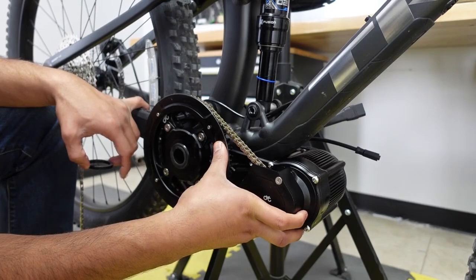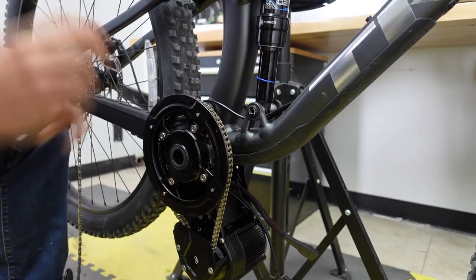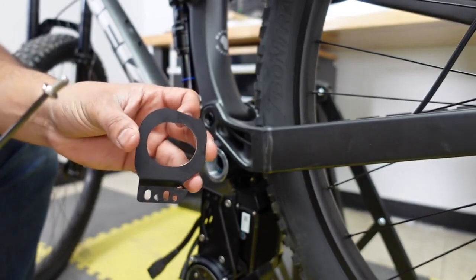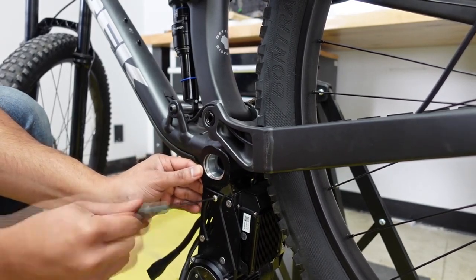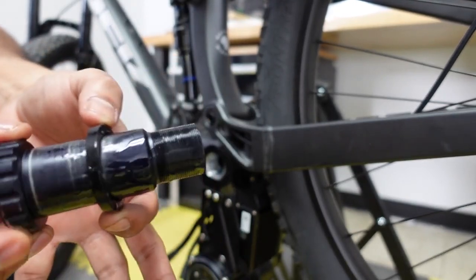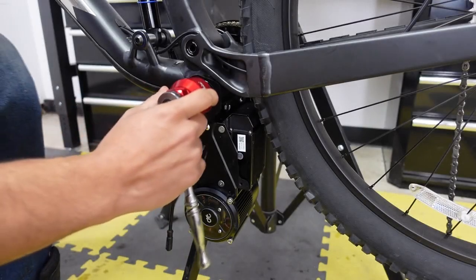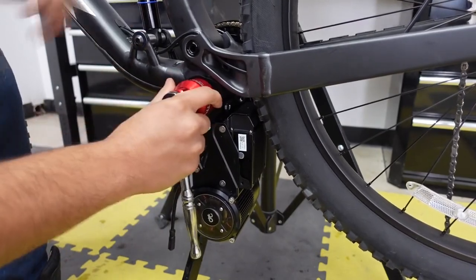Some full suspension bikes have an ISCG mount, which this bike also has, but it's not hitting it so it's going all the way up, which is really good. The CYC has two controller mounting positions — just unscrew the two bolts on the other side and lower the controller position and it will fit most ISCG mounts. Now work on the non-drive side: use the mounting bracket that came with the kit and the two bolts, use a three-millimeter hex and tighten it in. Then insert the five-millimeter spacer for the BB92 non-drive side bottom bracket cup and engage it in the thread. Tighten it with a Lekkie 1644 socket and your motor and controller should tuck in nicely.